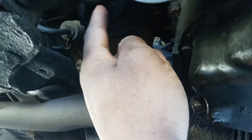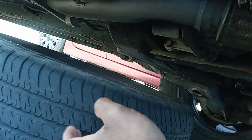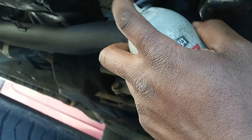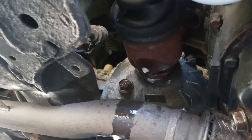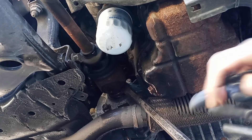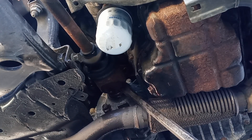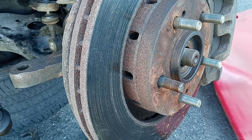The usual reason you change these is because of clicking or the rubber boot leaking — mine is leaking and there's a small clicking inside the boot right here, so just change it. Remember, for safety keep the tire close to you underneath the car. Go ahead and spray between the transmission and the axle itself. The crowbar goes right between the axle and the transmission, and you pry it out.